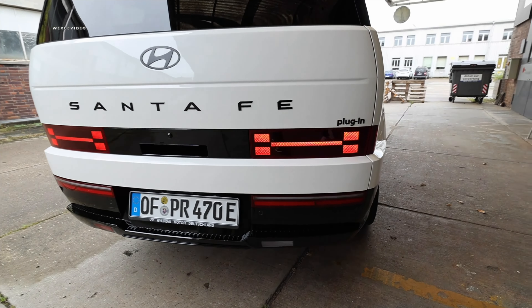At 3.6 kilowatts, it's kind of like an elevated socket — charging takes about five hours, which I find somewhat disappointing. Many people want to use the plug-in hybrid for shopping trips, recharging during a one to two hour stop. What all other derivatives now have is a CCS connection for fast charging — the BYD at 18 kilowatts, while the VW derivatives, Mercedes variants, and Porsche Cayenne can all charge at 50 to 60 kilowatts. Write in the comments how you view the charging capacity and battery size.